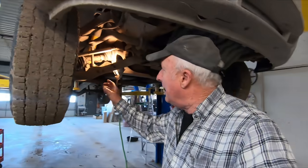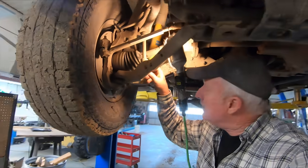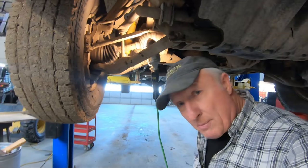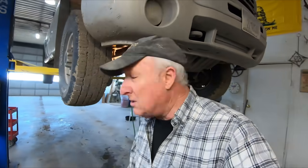I've also got these front shocks - the rubber's gone from the bottom of the mounting. I could replace just the mounting, but I think I'm going to go ahead and put new shocks on it. They probably have 40,000 miles on them, so I'm going to put new front shocks on and look it over so this truck is worthy for the trip we're taking next week.